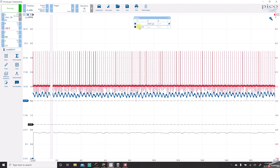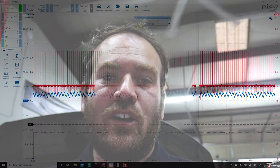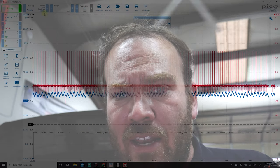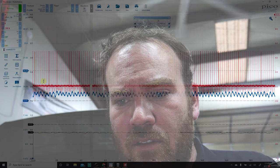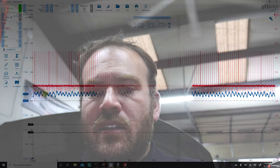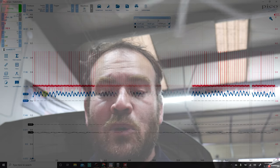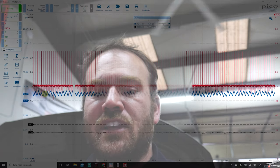Now that I've opened up that vacuum leak, the engine is loping — it's having a hard time figuring out what's going on. I could unhook the mass airflow sensor to put it in limp mode so the idle might stabilize, but let me see what RPM we're at and what our oil pressure is. Going based off an average — we are at 12 and a half psi and we dropped down to 734 RPM. So we're 200 RPM lower, yet we still went up on oil pressure.